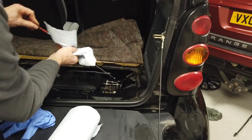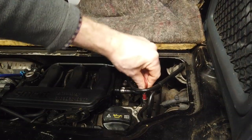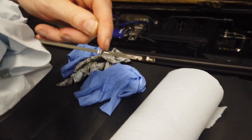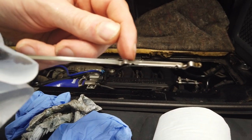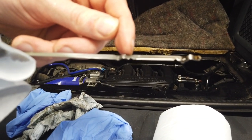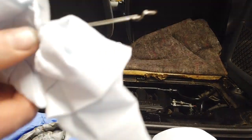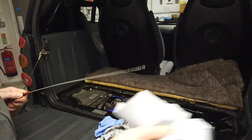Final dip and then we're done. He's just below maximum which is perfect. You can see he sank a bit as we started the engine and it filled the oil canister up. So we're all good to go — oil change done, tidy everything up and we're off.